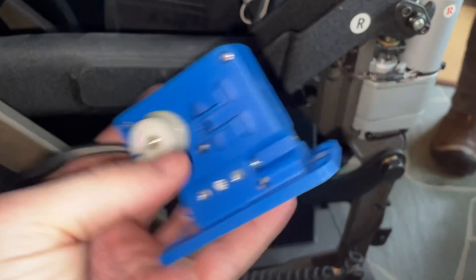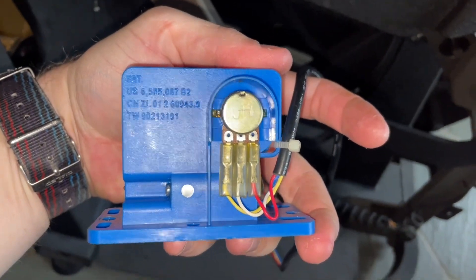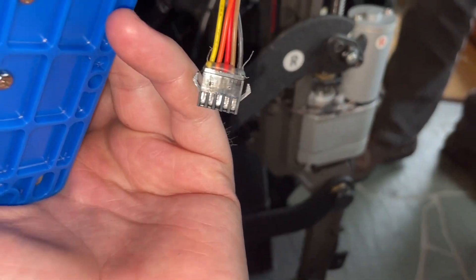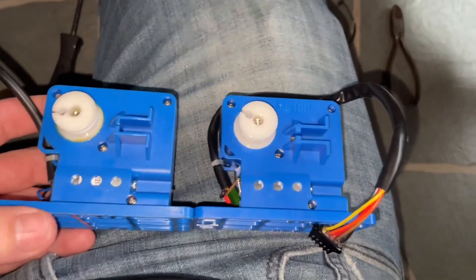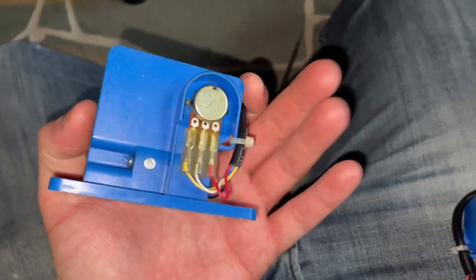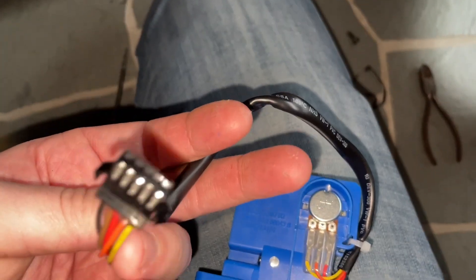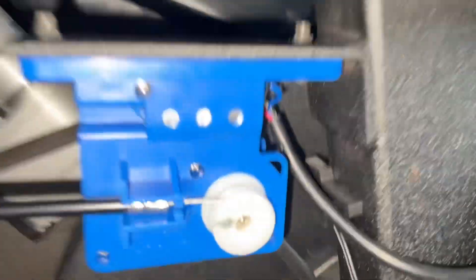This part kind of sucks, but here is the servo motor assembly. You can see the potentiometer on the back — pausing just for the part numbers and the patent there. The Q45 uses a white plug for the electrics, and the one I purchased is a black plug, unfortunately. Essentially the motor itself was fine on mine, but the potentiometer was bad. So I ended up splitting both of the cases apart, and since the potentiometer just has little pin connectors, I was able to transfer the harness and the old motor into the new housing, and everything ended up working fine once I did that.